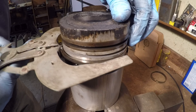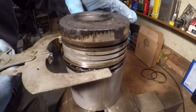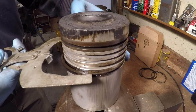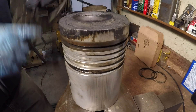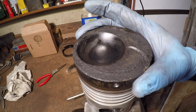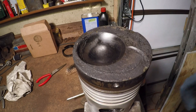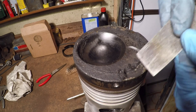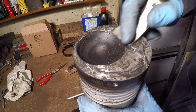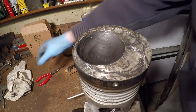Get the third compression ring off, first oil control, line on the bottom side — catch the gap, comes right off. Second oil control, easy as that. Now to get some of this carbon off so I can have a better view of what I'm doing. You can see how loose that outer ring was — it even pops up and down on the threads, really starting to loosen. Man, this whole thing was an oil burner. This carbon is just thick on here. You could say it's a hybrid: diesel fuel and engine oil — burns them both.